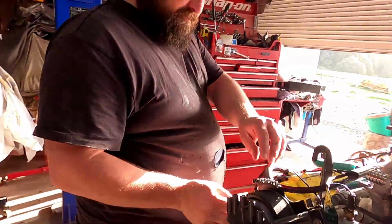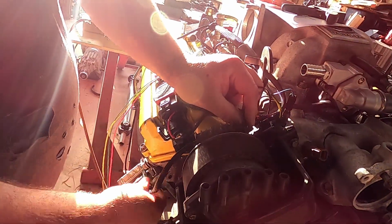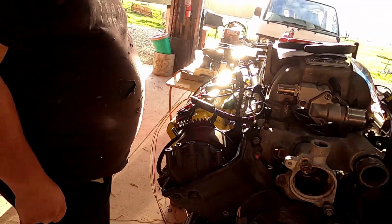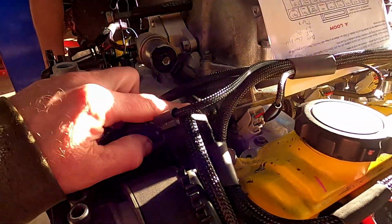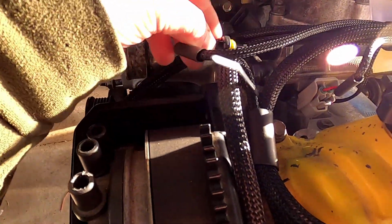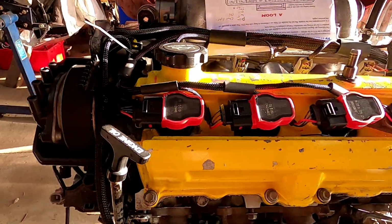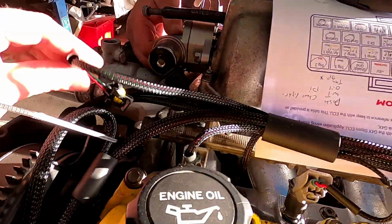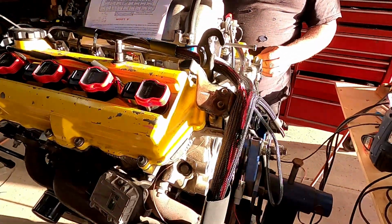This one's sort of the same. Yep, so that gives a nice short track for the earths. And you've got this plug here for fuel pressure, which is sort of planned for that front banjo bolt. The ghost one. But it would need a cut if it does ever go in. Technically this wasn't set up for a fuel pressure, but we've allowed for it just in case to have a fuel pressure sensor. It can give better mapping.